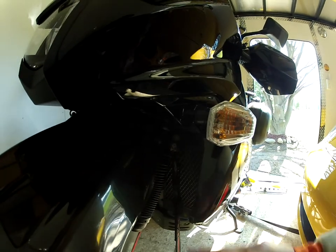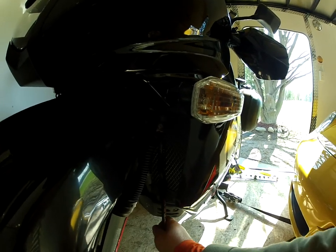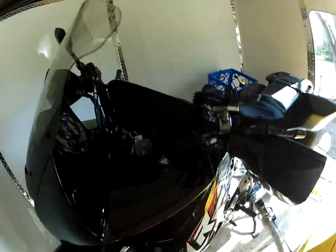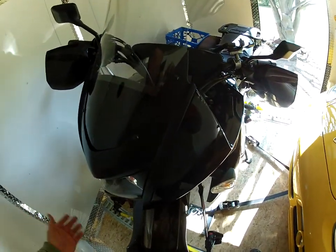The guy at Bud's Chrome Nuts, where I bought the motorcycle, told me about these eyelets. You buy these little eyelets — they were about $8 a pair — and they go in your lower fork bolt. That just straps this thing down as tight as can be. As you can see, it's not touching any plastic work — you don't need soft ties, no chafing on the side.